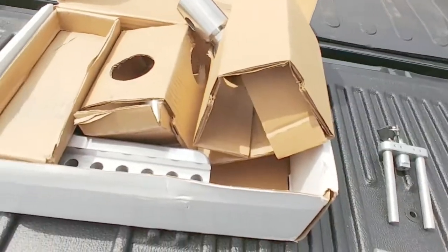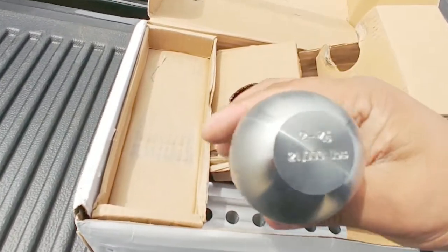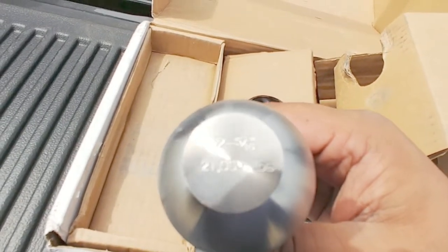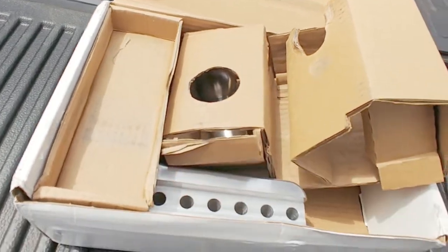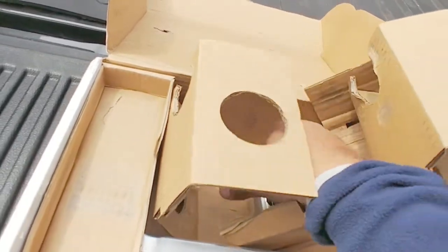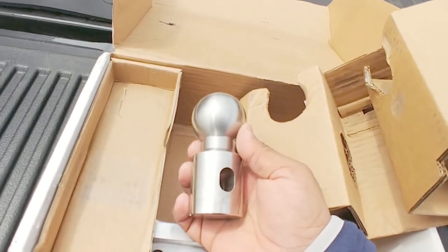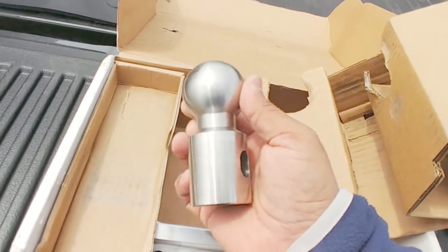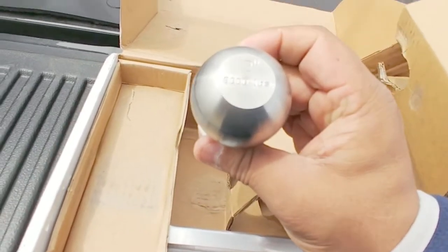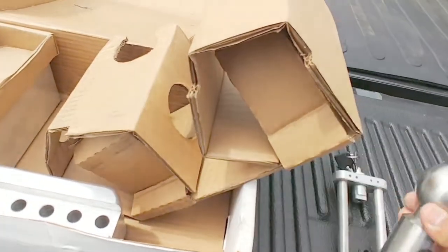Here's one of the balls. It's rated to — you can see it says — 21,000 pounds. That's right, 21,000 pounds. It's two and five-sixteenths. You might be wondering how a trailer hitch can hold 21,000 pounds — believe it or not, this Ford F-350 is rated to tow 21,000 pounds, and the tongue weight it can handle is 2,200. This is the two-inch ball, and the two-inch ball is rated to 8,000 pounds — most of them you'll see are rated to 7,000, so that's pretty good.